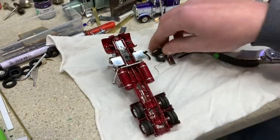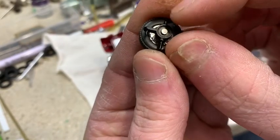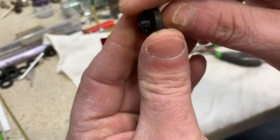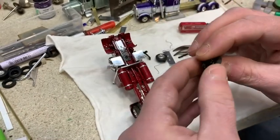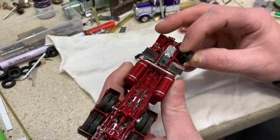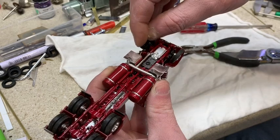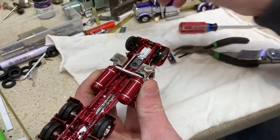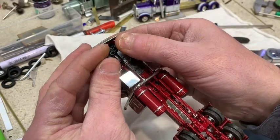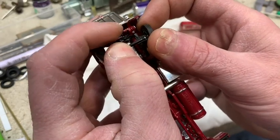So we've got our truck here. Like I said, another thing that you can look at is when you flip it, originally where your tie rod attached, this point was down. You're going to put it so it's in the up position, but this part will always be towards your rear drives. So you just put your spindle in, take your other side, set it in place, take your springs, set them in place, hold it, put that side on. Get this side on.